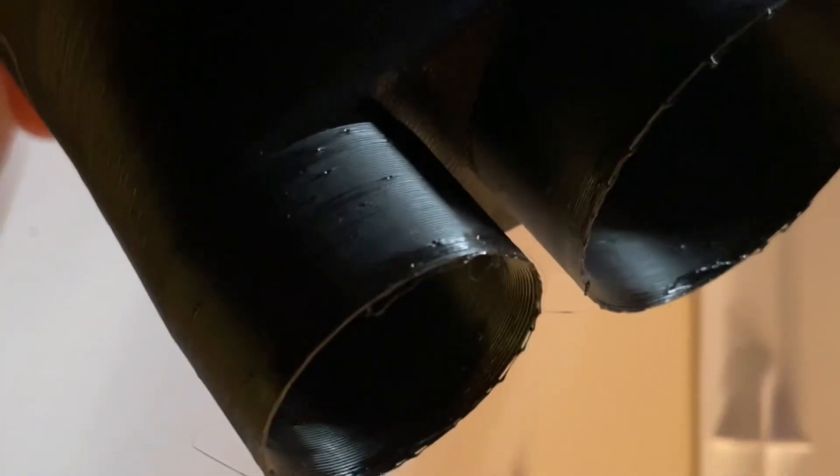It's Wednesday night, a weeknight, and I'm trying to press forward on this heater duct installation on this diesel fired furnace. I got some 3D printed parts here that I'm going to go ahead and show you and try to install. This part takes two metric-sized ducts and adapts them to a conventional vent — this is made in Elkhart, Indiana, so this is a suburban furnace vent. I got rid of my propane suburban furnace; now I've got two diesel-fired Chinese heaters, and this is going to give me heat from both of those in one location.